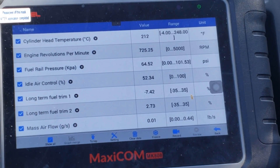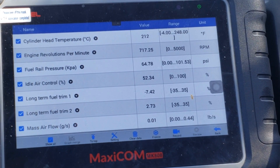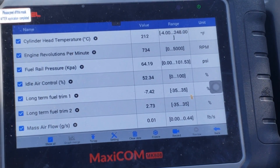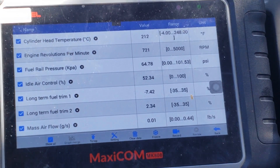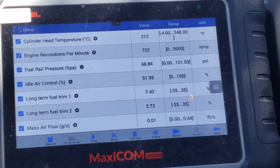If it's open at a very high percentage, then your air filter or PCV valve could be restricted. This idle air control valve is functioning properly — no need to replace it, no need to spend unnecessary money. It's functioning just right.